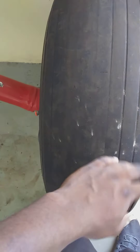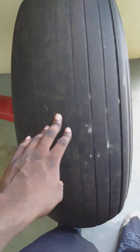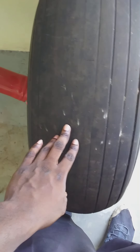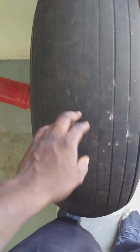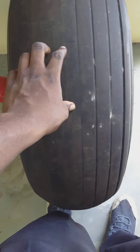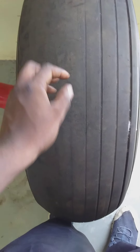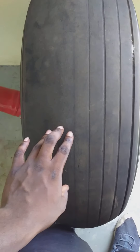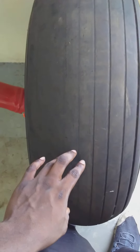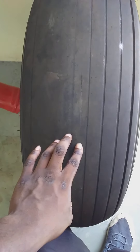You could see the tire may have rotated and the inside has worn more than the outside. At this condition, this tire is unserviceable because the tread has worn down to a point where there is no visible tread. I also look for any exposed canvas and any impaled objects like nails and burrs, and dig them out to make sure they haven't punctured the tire or tube, if it's a tube tire.